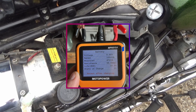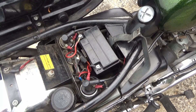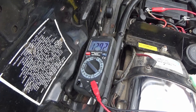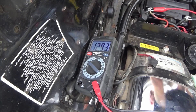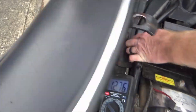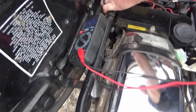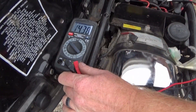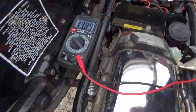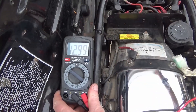The battery was goosed, so I got a new battery and put that on - as you can see, nice new battery in there. Checking the voltage and it's pretty high. I'll get it started up and show you what I mean. We're at 12.9 volts at idle.